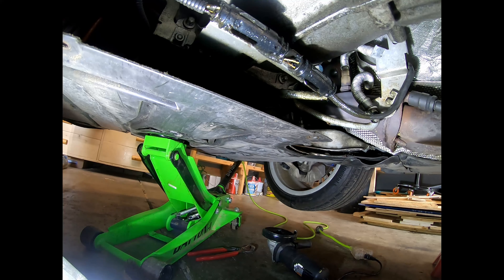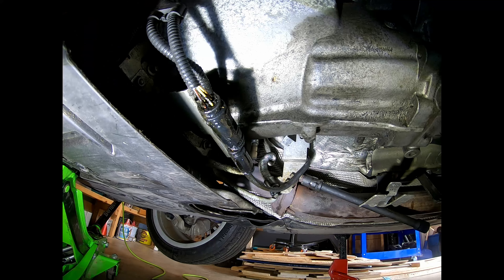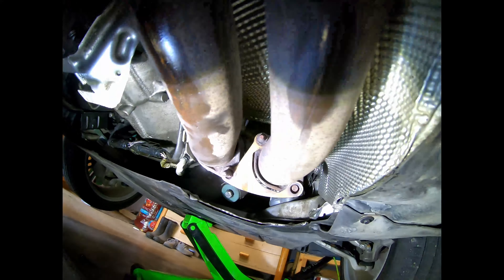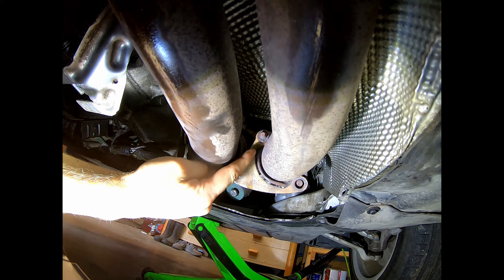My Milwaukee just snapped the stud right off — not good. So you can see here I'm cutting off the nuts. I first tried going at one angle but that didn't work; this angle was much better. I cut off about half of that nut and then — though I didn't capture it very well — you can see me popping that nut off the stud.